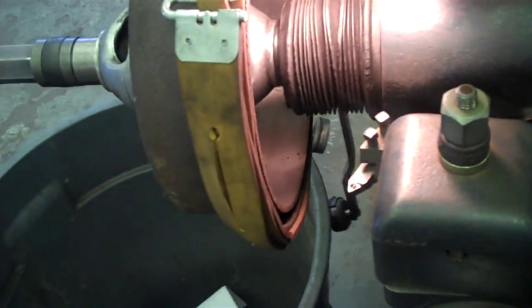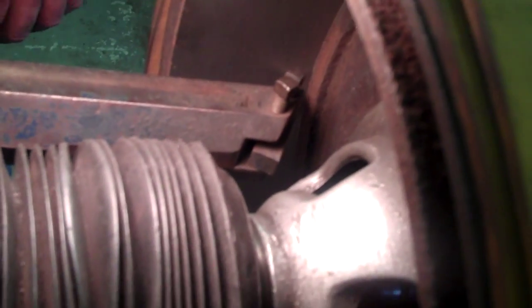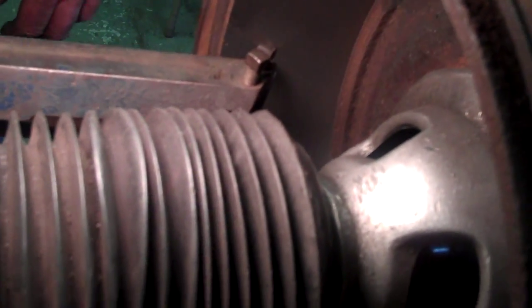Same thing as the rotor — we've got to do a scratch cut. I'm going to first set my bit up. I'm going to put my bit all the way in the back part of the drum. I'm going to let it hit. Once it's hitting there, you tighten your nut. We have the drum set, we have the bit set. Now let's back the bit off and run the drum all the way out. We're ready — let's do our scratch cut.